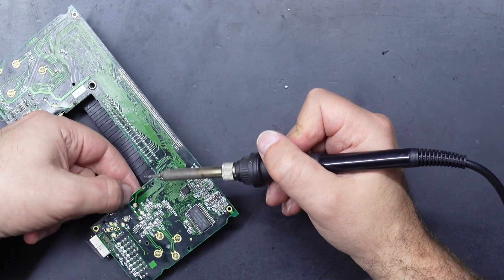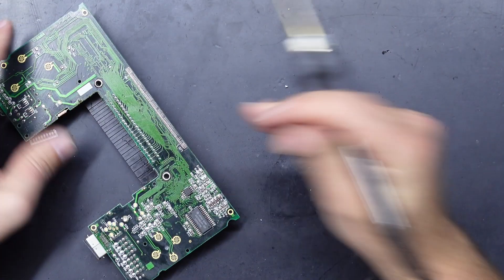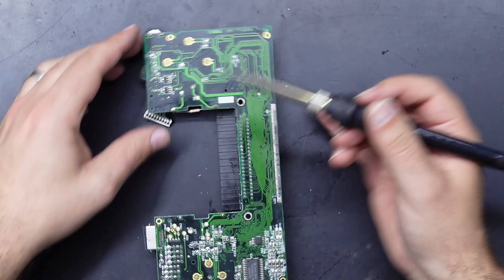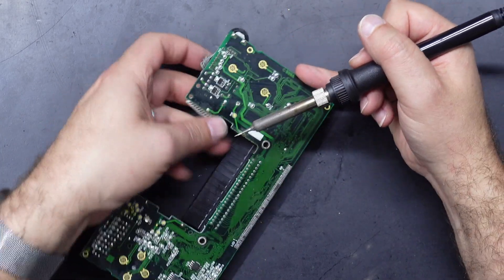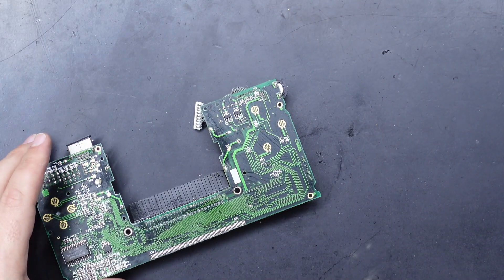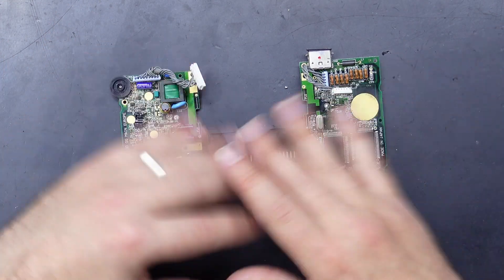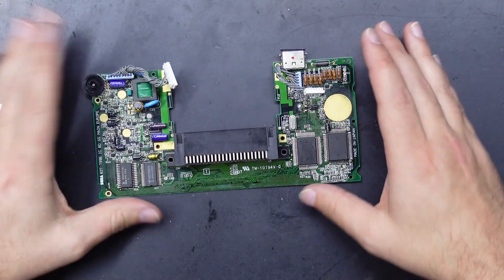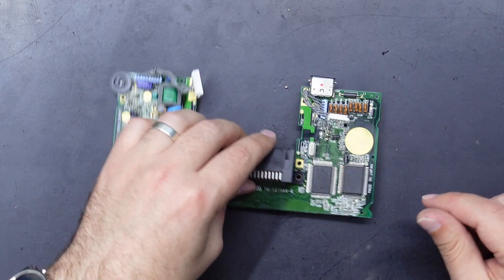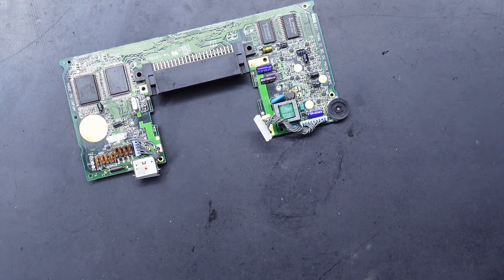So there's the McWill version, I think Retro 6 brought out a version, and also Retro Kai. They all use a TFT LCD, so they're all going to look more or less the same. Because the Benven screen uses an IPS panel, it should hopefully look quite different. I haven't tried out the Retro 6 or Retro Kai screens — I believe the Retro 6 has a flat flex ribbon cable that loops around some of the components, and Retro Kai has a board that makes it easier to solder to those pads. But I'm not actually going to be using them, unless I've made a colossal mistake, which is quite possible.